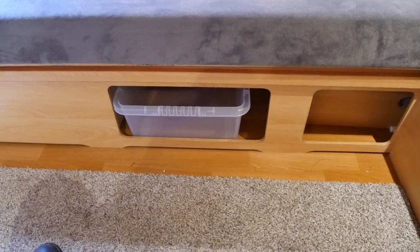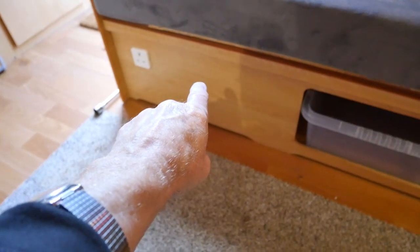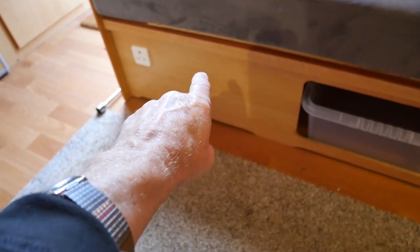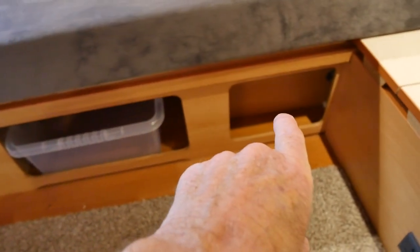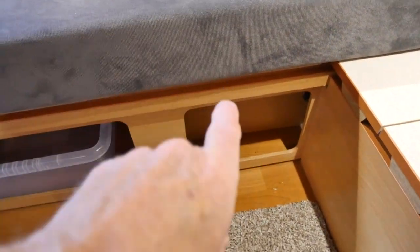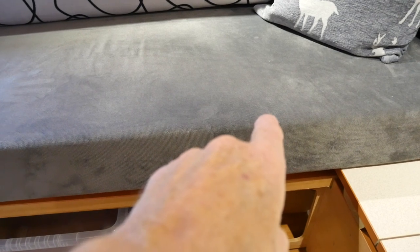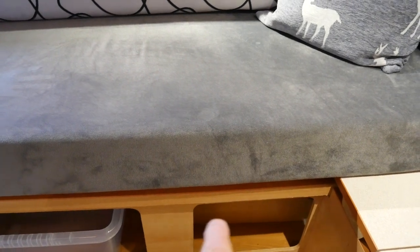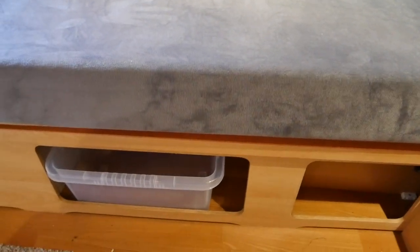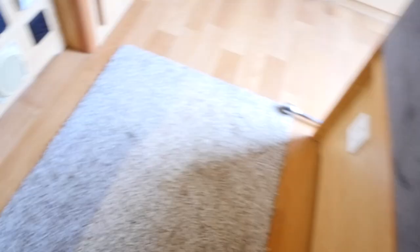This section here has a lot of electrics — it has the 240 to 12-volt charger in here at the back. I've moved the 12-volt battery from here to there, and behind that, underneath, is where the AC comes in with the circuit breakers and so on. We've gained that storage space, which basically makes it more useable for us.